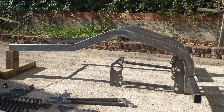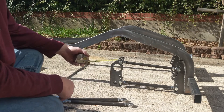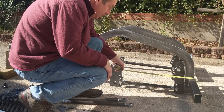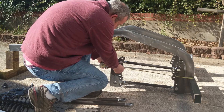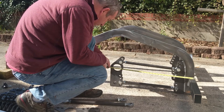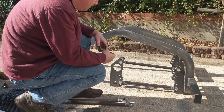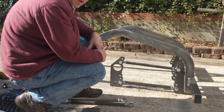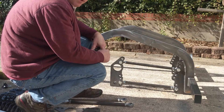I've got some blocks of wood to get it a little more level. So I'm measuring from the front of the crossmember to the front edge — and that gives me 25 and a quarter inches. I'll just add an inch and a half for the diameter of the axle too, and then we'll use that measurement when we go to the car.